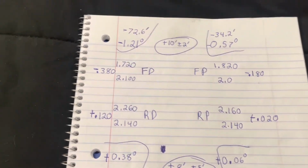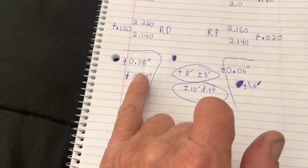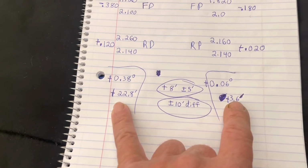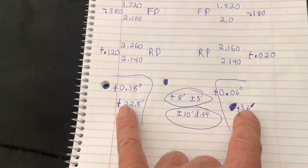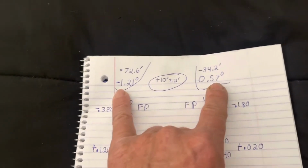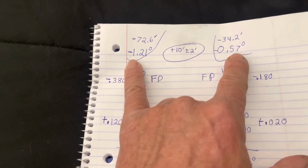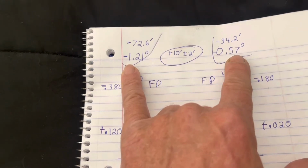So I'm gonna go make my adjustments. I am going to have to adjust the toe on this side. The toe actually looks pretty good on here, so I'll be able to do the camber adjustment, and then we'll see where we are from there. And as far as the front goes, I'm gonna do the toe adjustment. I'll do a freeform toe adjustment, and then when I reset up my rig, I'll do the toe adjustment with it in place.